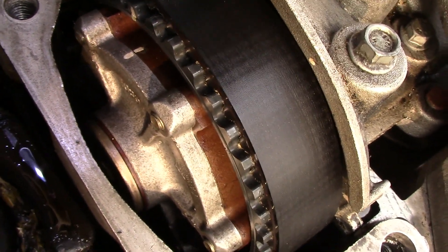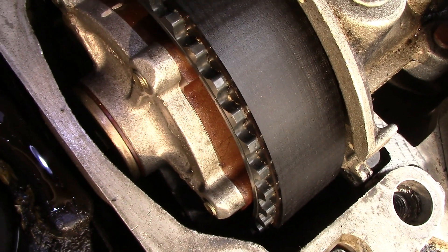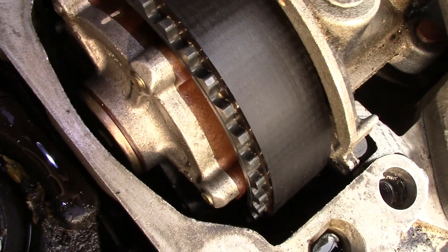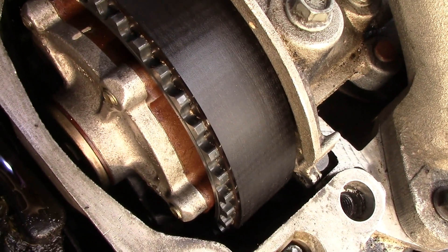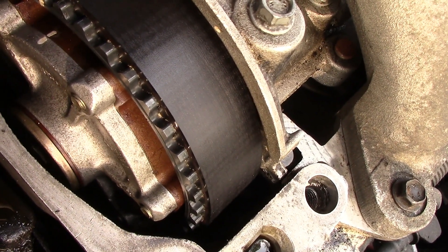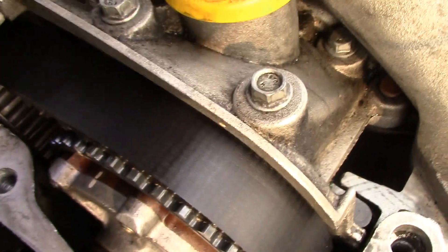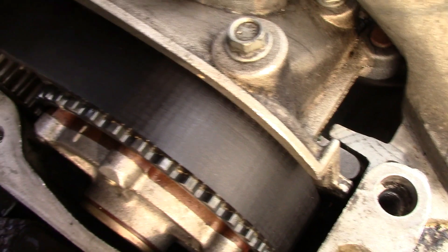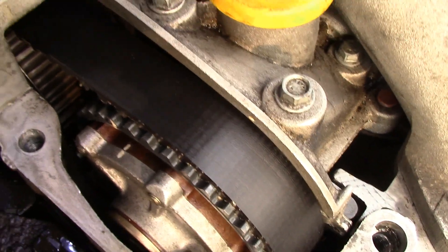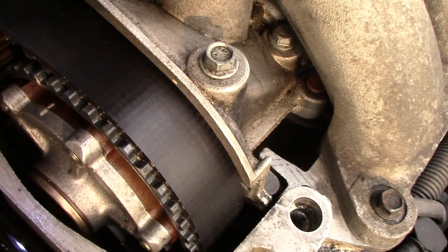Now the problem with that is I ain't getting to that unless I pull this whole engine out and apart, and I ain't going to do that until it needs its next cam belt, which is actually in a few months. So maybe we'll look at it then — either replacing those oil seals, or if it's the outer connection to the cylinder head we can just gum it up with something. All in all, can't go any further than that for the time being, but at least we know what's doing it. I must have installed one of those cam seals wrong, or used the wrong type or something. Well, that's all I'm going to do for now. I'll probably make another video when I do the cam belt and adjust everything. See you guys later.